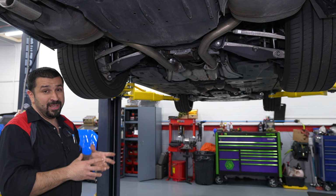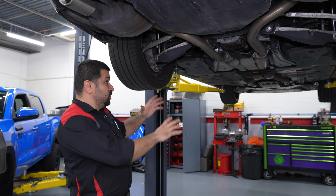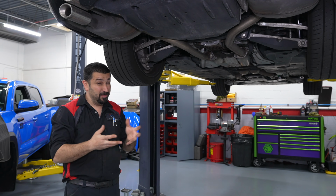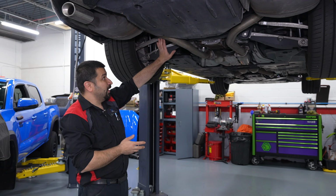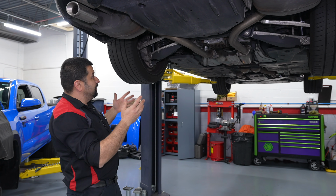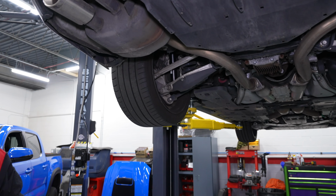If you take it on track, there's better cars, but this handles very good for what it is and how reliable it is. All this stuff looks like a massive complication, but actually very reliable. They don't really have issues. Yes, when you do an alignment, you gotta adjust the toe as well. There's a little bit of a procedure to it, but nothing really extreme. Here's that other shock that we replaced. We did end up replacing both rear shocks.